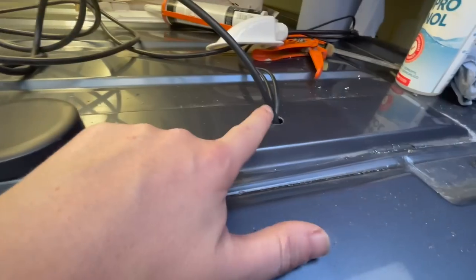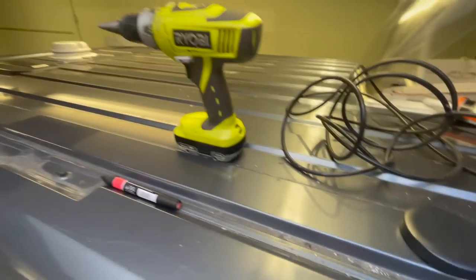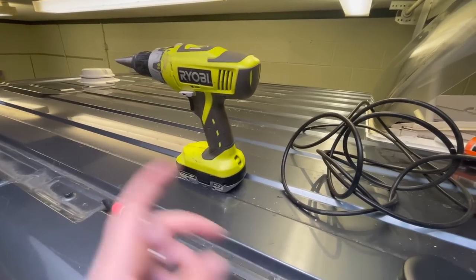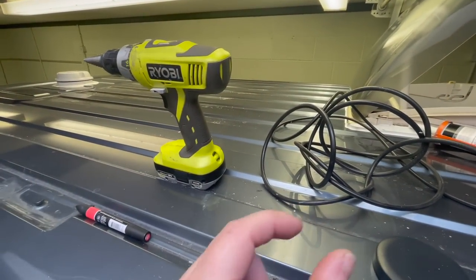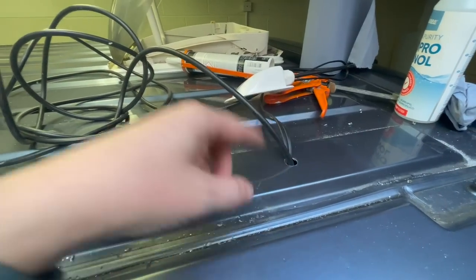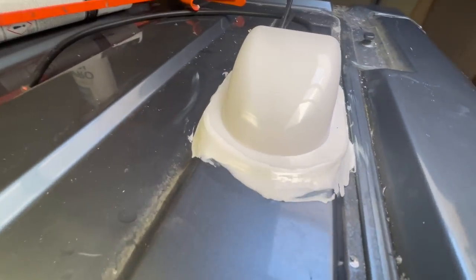The puck's in — I've drilled the hole and used the step drill to make it big enough for the cables. Because Mandy changes her mind all the time, John thought it'd be good to put extra cables in. This one is for my solar panels — we've got two 175W panels going across the van, and they'll fit within about a centimetre of the available space. I've given the surface a clean and I'm passing the cables through, then I'll Sikaflex it and make sure hell or high water cannot get in there. I keep saying to John it's like an alien has vomited Sikaflex all over everything I do — not the neatest, but I don't think any water is getting through there.